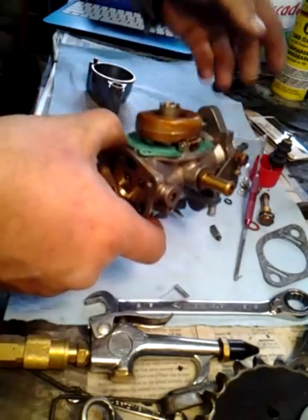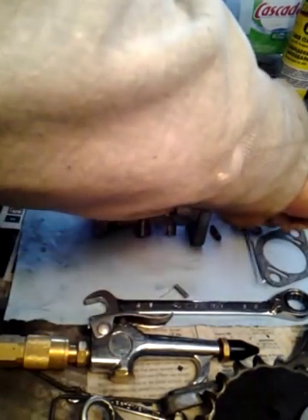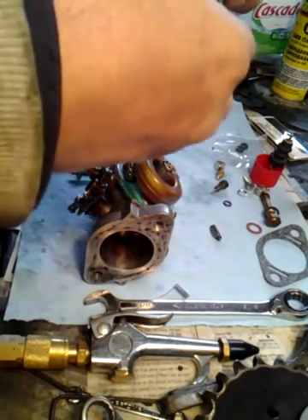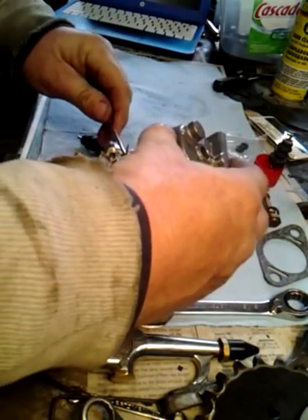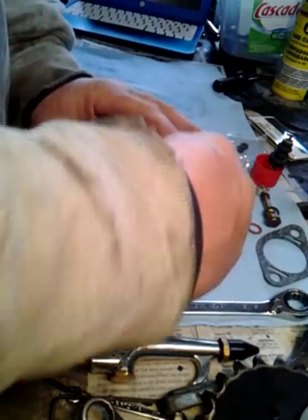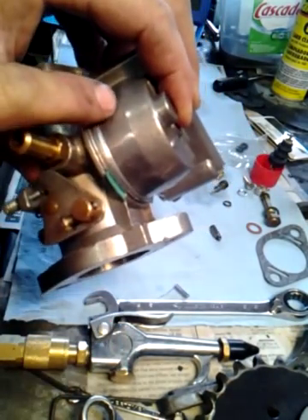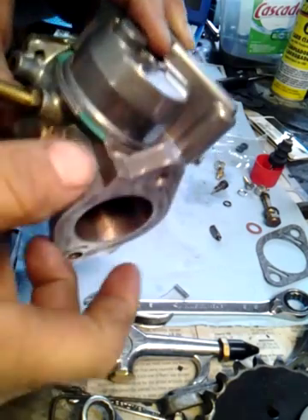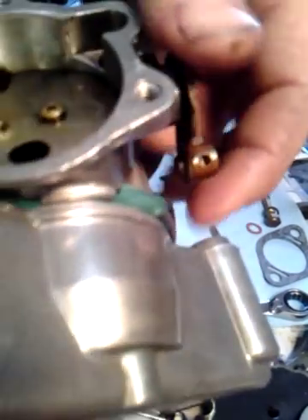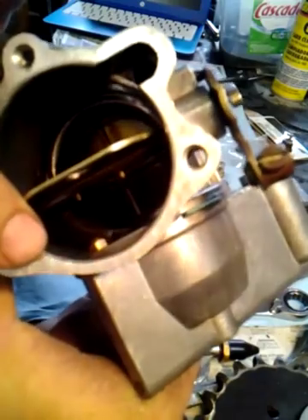I put my drill bits away before I decided to make the video. But here you go — it's a little tricky to get this sucker in there sometimes. But that goes in there first try. It's sitting up against the side of the float bowl here. There's your inlet. Your nozzle's over here — if you can see it. When I open the choke, see there it is. Now that's another tricky thing to do is clean that little nozzle when you're cleaning.